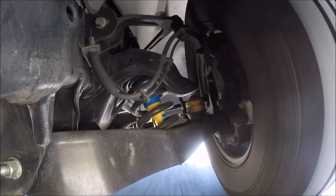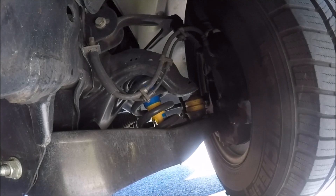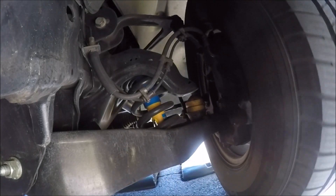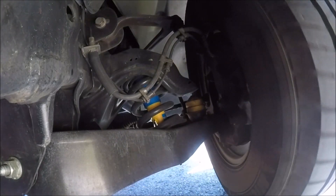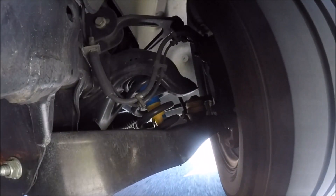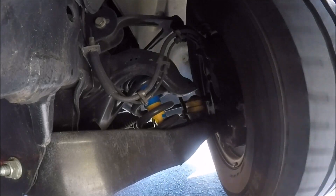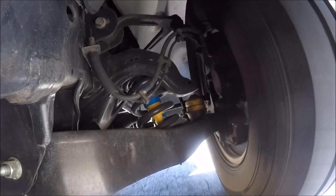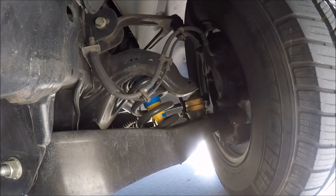This view is looking forward from the right side of the vehicle, and as you can see, the whole lower control arm moves during forward braking or reverse braking — anything that prevents the wheel from moving. The weight of the vehicle and its forward momentum really put stress on the lower control arm, pushing the bushings to their maximum worn position.